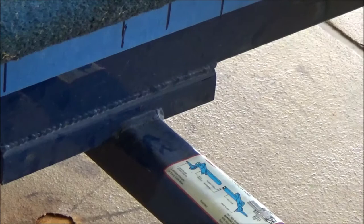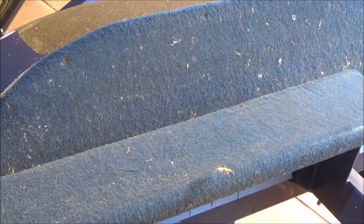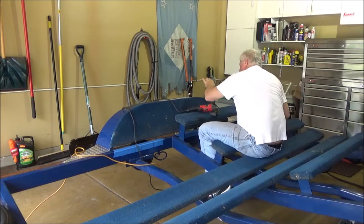So again, I think I mentioned it before, but I'm doing a 1-inch piece of tubing simply because I think that'll get me enough for most of it. Then I'm going to cut little ovals up there so that if the suspension fully compresses and the tire might make contact, it's going to just poke through there. That way I don't have to have the truck exhaust go much further underwater to launch the boat. All right, that's it. Getting the right line of sight is going to be fun.